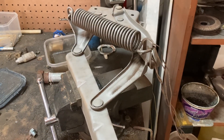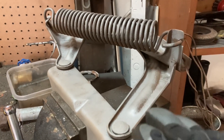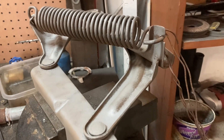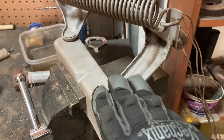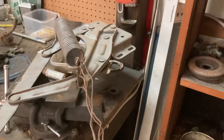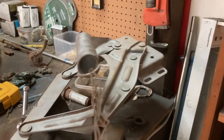I would recommend removing the spring from the hinge because it will make the hinge have less height, which requires less volume to completely immerse it. The way I remove the spring is to simply put the hinge in a bench vise, wrap a couple layers of wire around the spring, pull back on the wire, and pop the spring out.